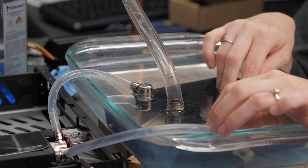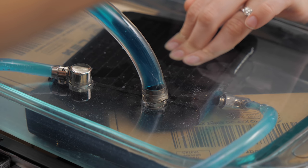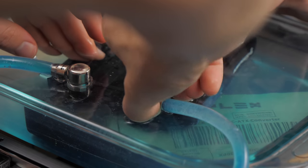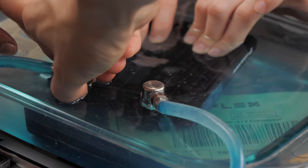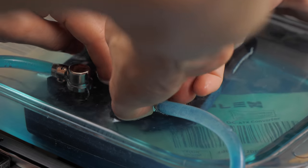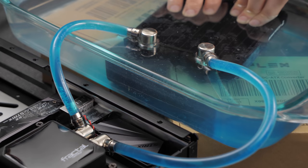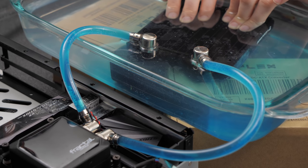Air wouldn't pull inside the radiator because of the fill line. What I did next was pour dyed coolant into my tube and watched until I saw it pour out underwater at the loop exit. Being very careful not to bring the tube up over the water line, I screwed it underwater into the radiator. This was a pretty cool science experiment — especially because everything I predicted came true, which never happens in my lab. I had to repeat this process several times because of some latent air bubbles in the combo unit, but eventually I had a bled loop.